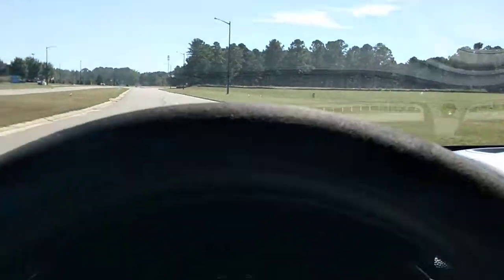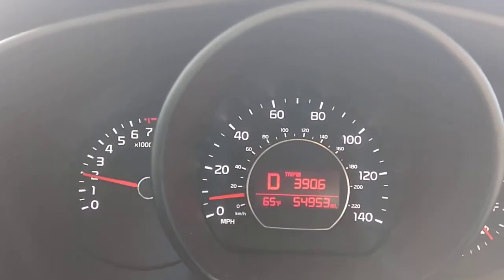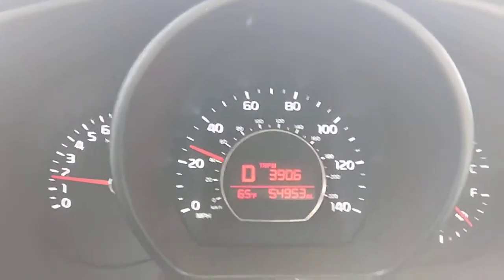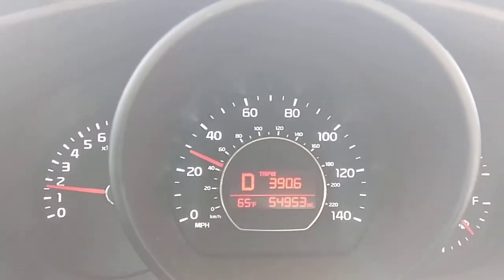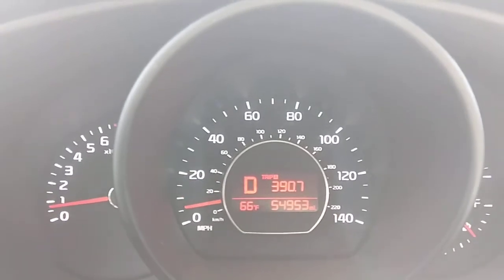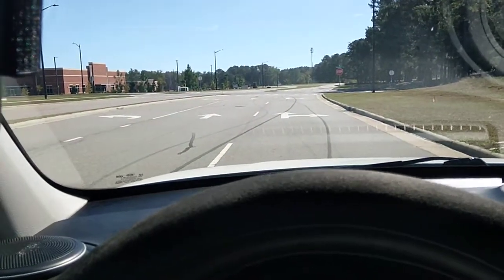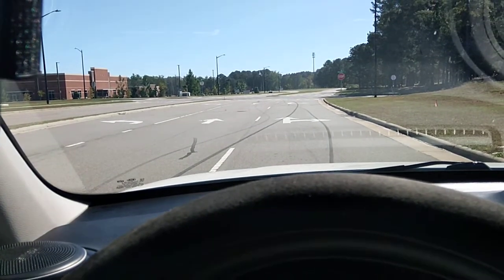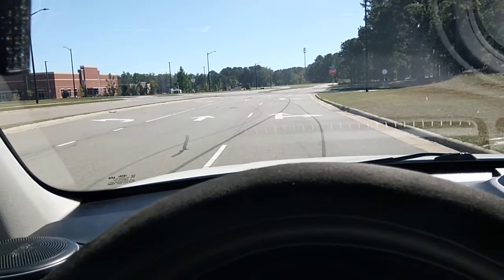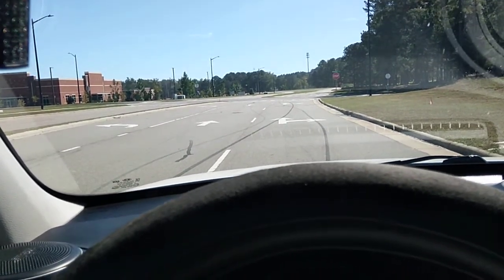It's 30 miles an hour, 30 stops, and then you hold for 30 seconds to let it cool down. You don't slam on the brakes — you just gradually push to a stop, hold for 30 seconds, and do that 30 times. What that's doing is putting pad material on the rotor and bedding everything in so you can actually stop the vehicle when you need to.